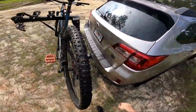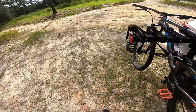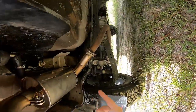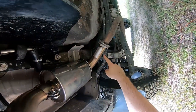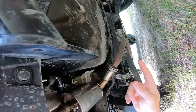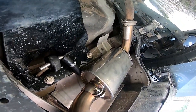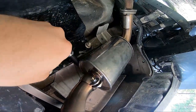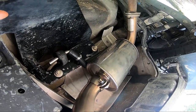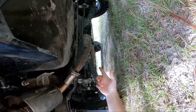I also got an exhaust on this thing - it's from LP Adventure, a company out of Quebec, Canada. That's the little badge they give you when you buy their products. Now if you're running a Class 3 hitch, that hitch plate is very beefy and the exhaust can contact it, so you'll hear a rattling noise. I used a little fuel hose with a hose clamp to reduce that so it doesn't annoy you. Other than that, that's it for the back. I do want to get some skid plates eventually - right now I'm running all the factory plastic skid plates and they haven't had any issues.